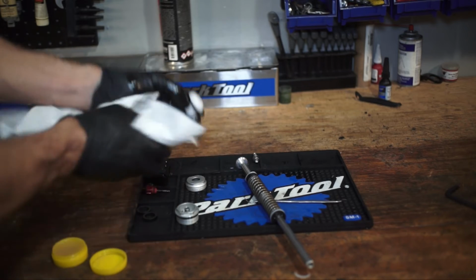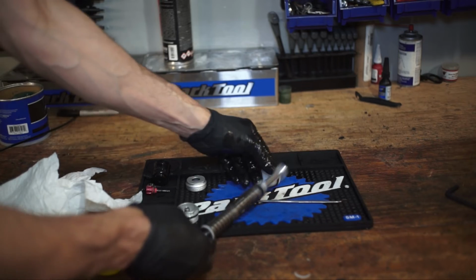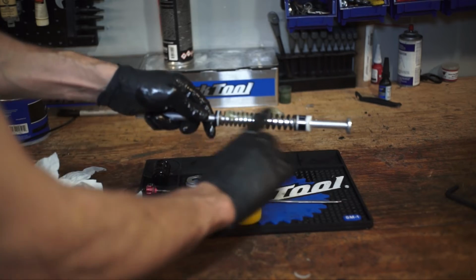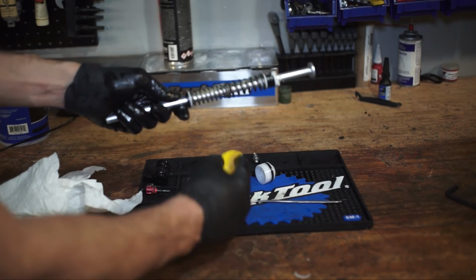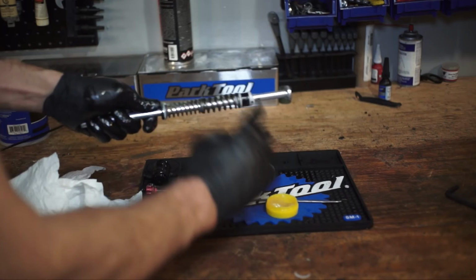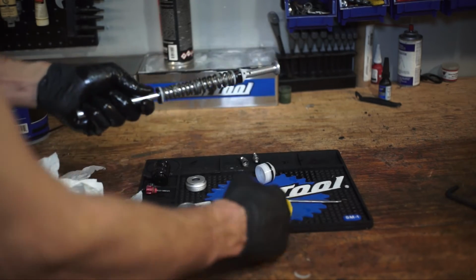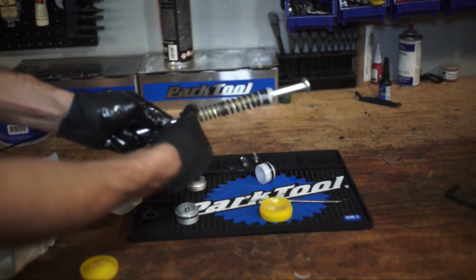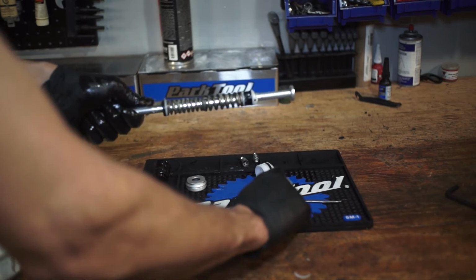This is your air piston top cap. Down on the bottom, everything fits together just like that. So now, I'm going to take our Con-Pana and just slather it all up and down this spring. Oops. And all of the little moving pieces of this, we want that covered back in Con-Pana just like it was before. It's going to reduce creaking and squeaking and shock noises.